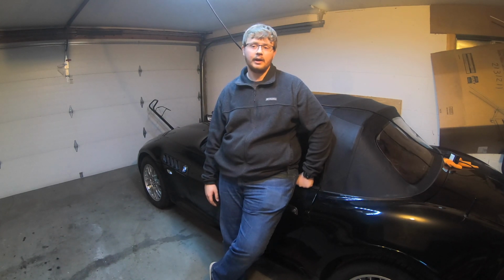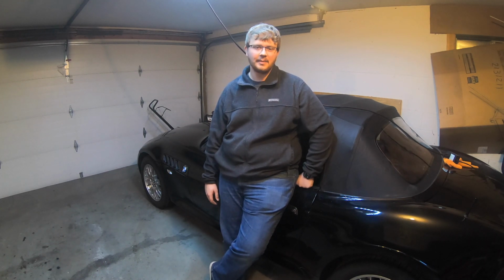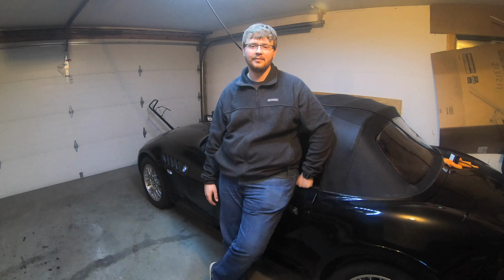So we're going to hit it with a wire brush and a die grinder, and then some rust reformer. We're going to make sure it never comes back, because I don't want to do this again. It's a lot of work, and I don't like my car being undrivable. With all that taken care of and everything nice and tidy ready for you, let's get into the video.